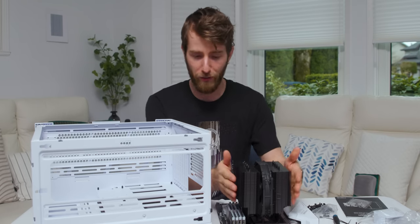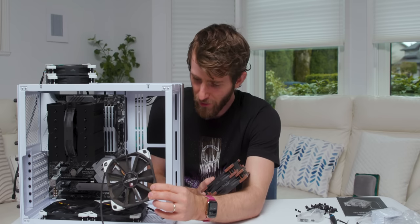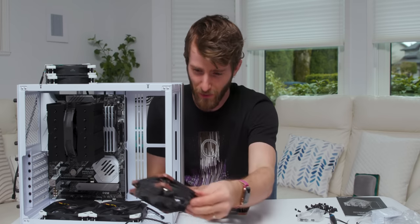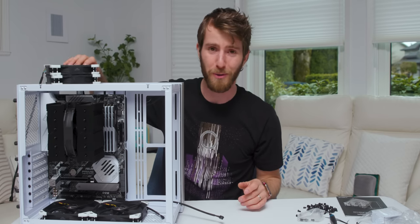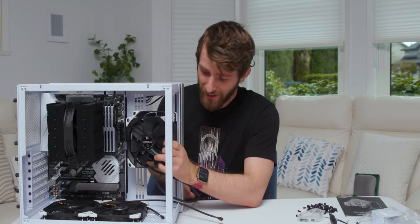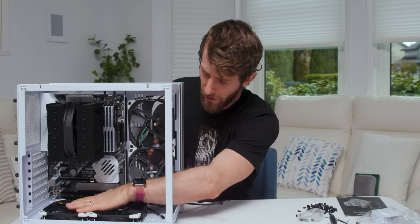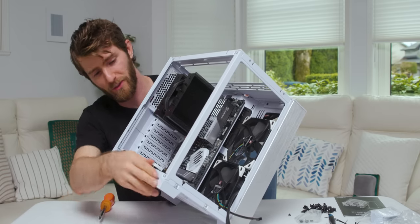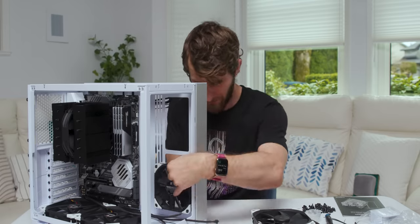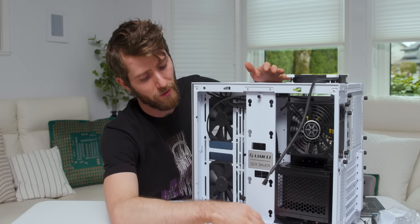The standoffs for the motherboard expansion piece are pre-installed, so you don't have to deal with that — sweet. My intention was to use 120mm fans, but the ones Jake sent appear to be from the old office whole-room water cooling setup and are absolutely filthy. So we're going with 140mm fans — two as intakes on the side to blow air over the power supply and hard drives, and two more on the bottom. The feet are clever — they've got a slot for the fan filter to slide in. There's a bit of trickiness with cable management until you remove the two-and-a-half-inch drive mount.